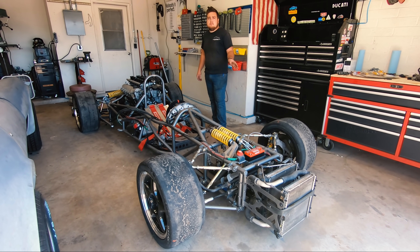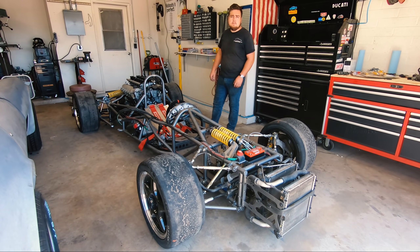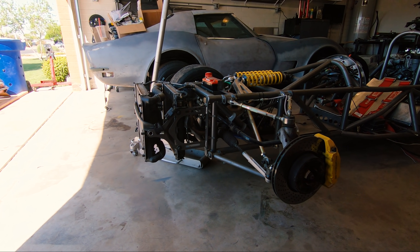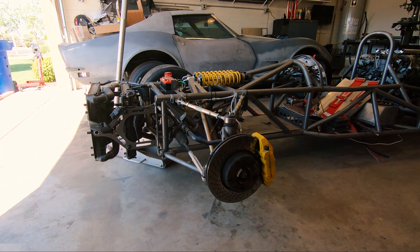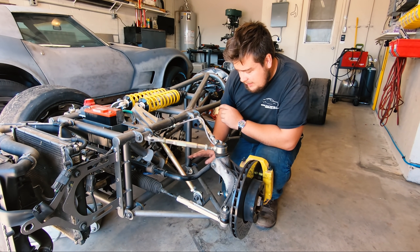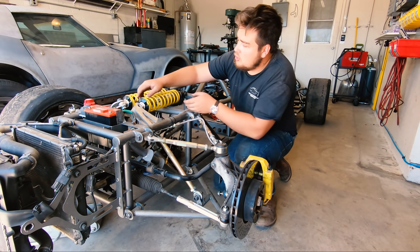We're going to be working on the front suspension a little bit, specifically this part of the front suspension. So we'll go over the prototype and a few things in a minute, but let's get started. This is how it's set up currently — it's a pretty standard double unequal length A-arm setup. We have a sway bar from a factory Porsche Boxster, the factory rack cut down a little bit, a lower A-arm, an upper A-arm, and then the push rod going to suspension.